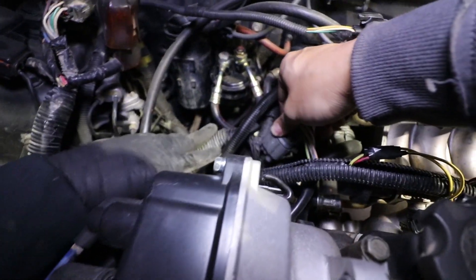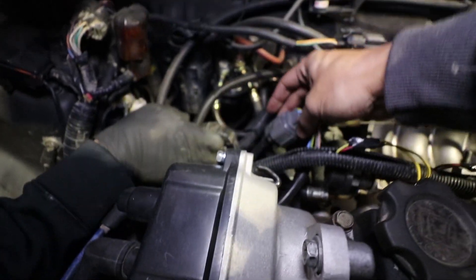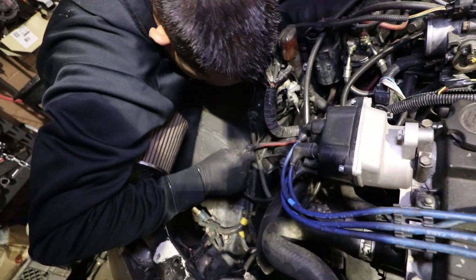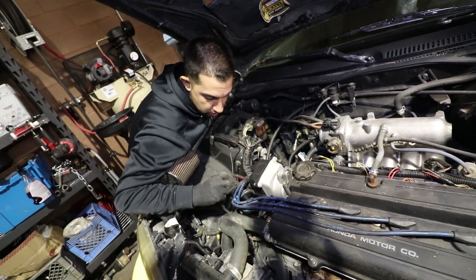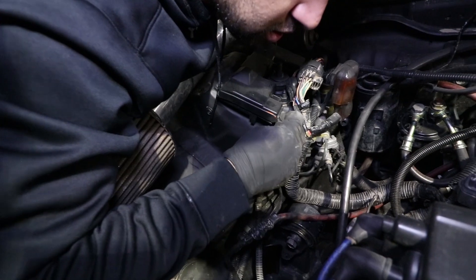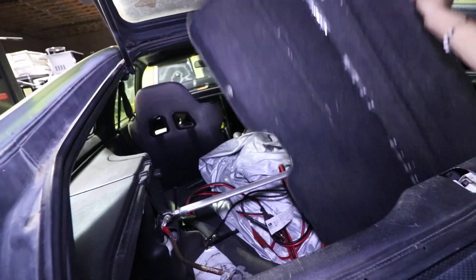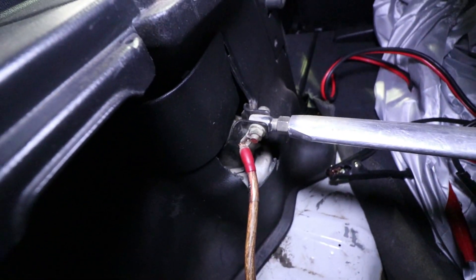Okay the bolts are a little bit loose, but it's in there. It looks like an aftermarket kit. I just don't know who put it or what it does. Usually you bash in that corner — and it's not touched at all. I wanted to see what those two lines came from. There was a speed sensor — somebody straight converted this bad boy. That red power line — oh, I see it right here — coming around, and it is straight to the battery. That's our voltage problem right there. It's feeding the fuse box.